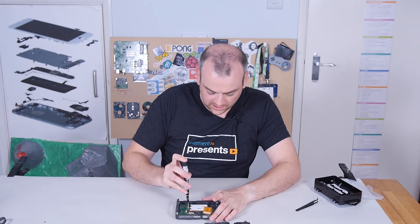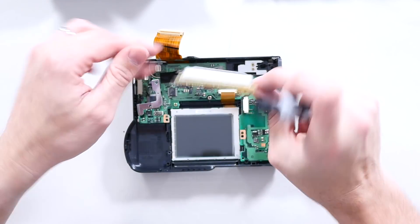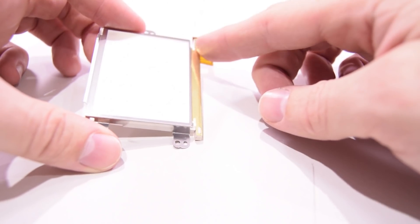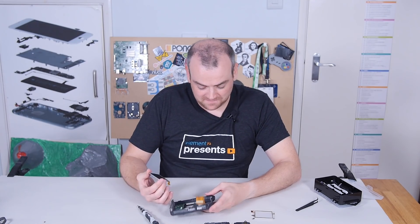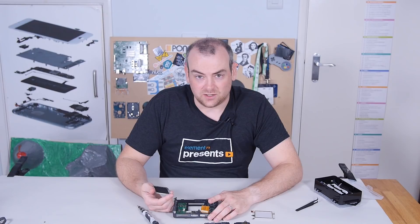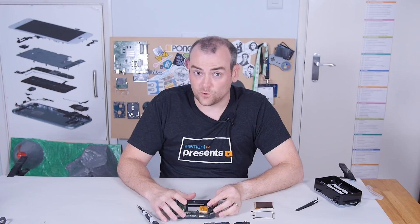Let's also talk about quality. Still quality out of this camera surprised me — pleasantly surprised me. I think by default it's a 0.8 megapixel camera. Videos, on the other hand, were posted as 16 frames per second at 320 by 200 pixels. That's not great — seriously not great. And when you actually watch the video back, like the introduction to this video, if that's 16 frames per second I would be staggered. It looks more like 4 frames per second to me.